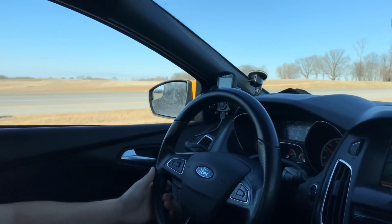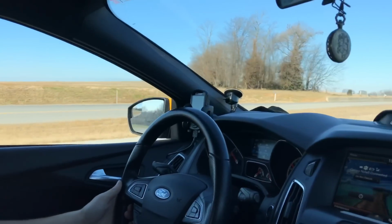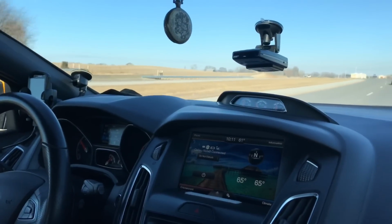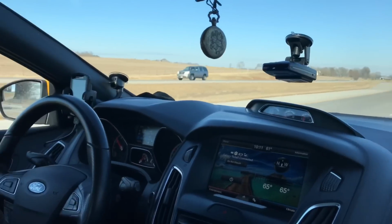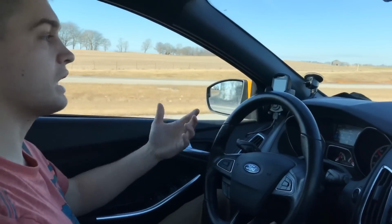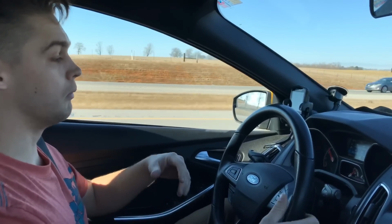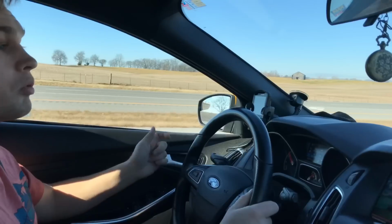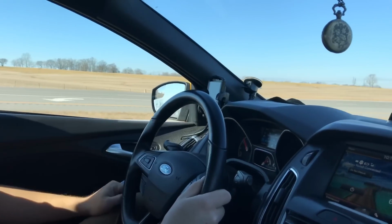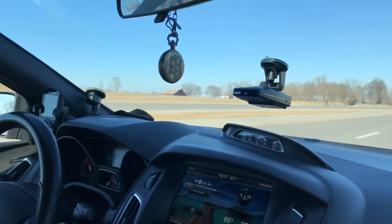This shows the big turbo that you have, and the pros and cons about it. Like I said, I got the 2867R Gen 2. I went with it because it retains some of that stock spool speed. It doesn't take as long to spool, but you still get all that top end pull. It will pull all the way to 7,000 RPM, it holds boost no problem, and I'll be in full boost by 3,800.